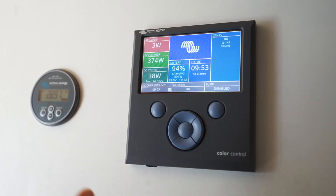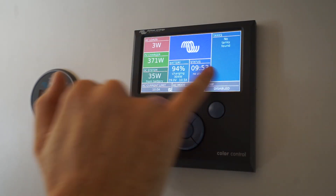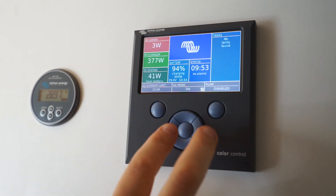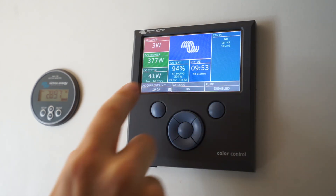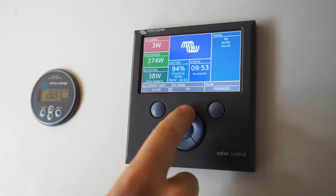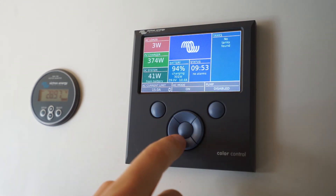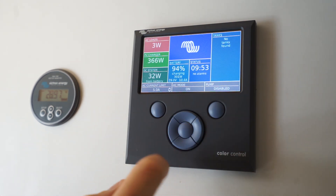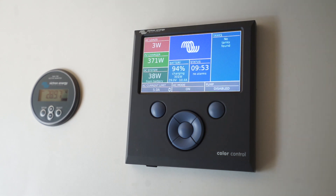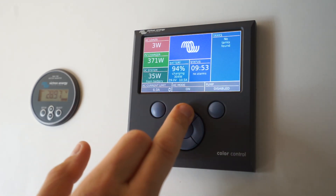The vehicle screen gives you all the numbers like before, but it also has tank monitor levels and AC current limit. There's a little pencil icon — you can change these options at the bottom. So if I want to change the AC current limit I can click on that and bump it up to say 15 amps, or limit it down to 5 amps. The reason you'd want to do that is especially in America — if you're on a power point at a campground that has a breaker on it and will trip if you draw too much power, you can limit your current down to 5 or 10 amps, whatever you want.